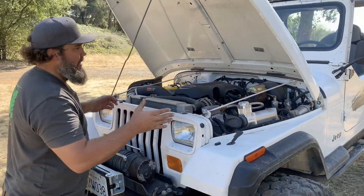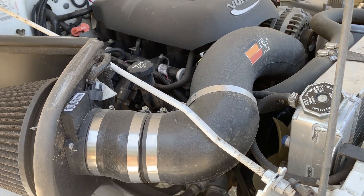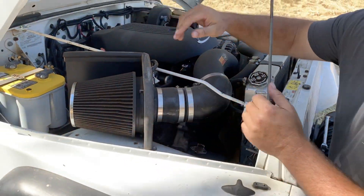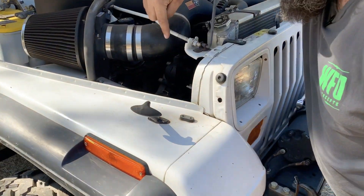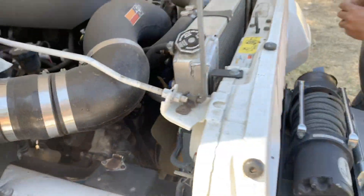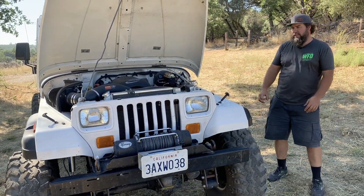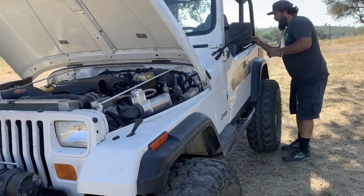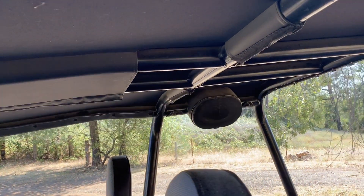There's onboard air with an air tank right here. Back when we had to smog this, we actually had to get an intake with the carb numbers on it — this is the actual Tahoe K&N setup, made into a sort of cold-air intake that wraps around and seals on the hood, sucking air from back there. We even put the winch controller remote on the inner fender well so it's not in the way up front. This Jeep came to us bone stock and we did just about everything to it. Even today, I don't think there's anything I would change on Willie's Jeep. It does have a stereo that kicks — we put six-by-nines up top and six-and-a-halves in the dash, and it rocks.